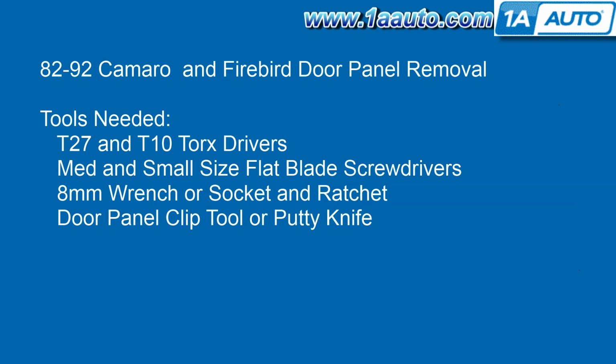Tools you'll need, provided that your car hasn't been modified: T27 and T10 Torx drivers, medium and small size flat blade screwdrivers, an 8mm wrench or socket and ratchet because you want to disconnect the battery as the very first step, and then you'll also need a door panel clip tool or a putty knife.